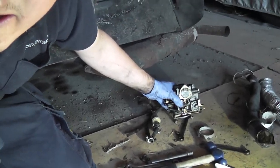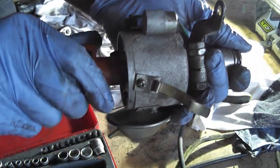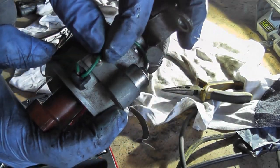For some reason my camera decided to have a bit of a notion and it died on me, so I lost one of my scenes that I had recorded — which is kind of annoying. But anyway, I have now got the carburettor reassembled loosely — I will be taking it back apart again just to give it a deep clean. I checked the distributor advance mechanism — I will just show you that again because the camera didn't want to play ball. So if you hold the shaft, you can rotate that against some spring tension. We will change the points, and there is some damaged wiring on the side of the distributor there as well that needs to be addressed — so we'll stick a new set of points in it.